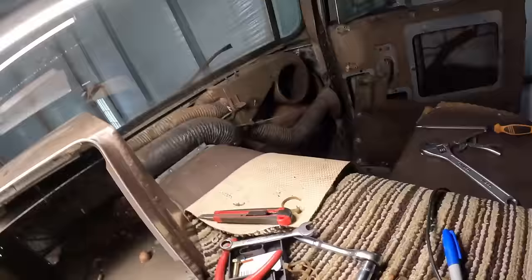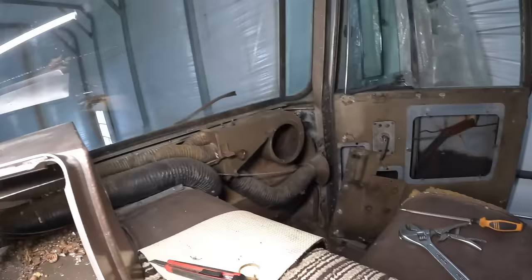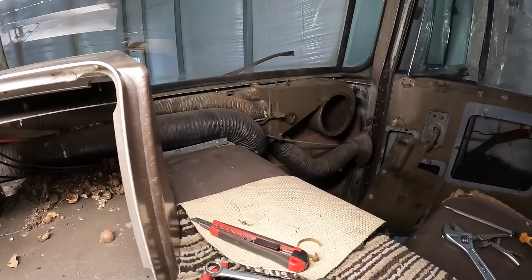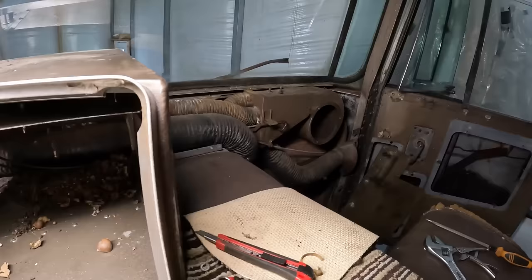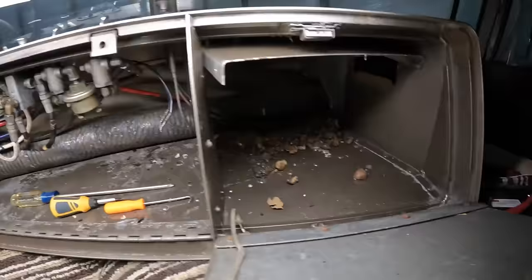Okay, and over there, we've got the electric window all apart because we have to change out the motor, because the motor doesn't work. And what else are we doing? Oh, that's the cover's off. We did get the squirrel cage motor running like a ding-dong, so at least that'll work. And we got to run the wiring out for headlights, turn signals, the electric window, of course, and the heater motor. So we'll start over there to the right side and run our wiring over. We'll get rid of the mice garbage. Rewire all this. We're going to leave those lines because they look pretty good. We'll give them a shot.